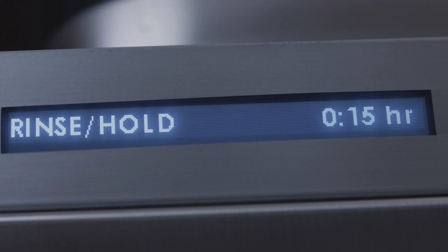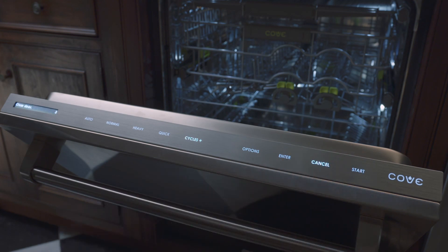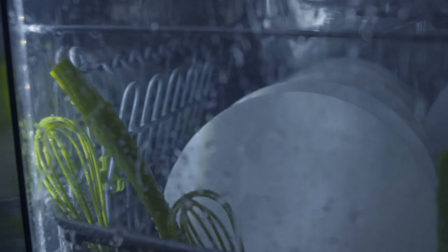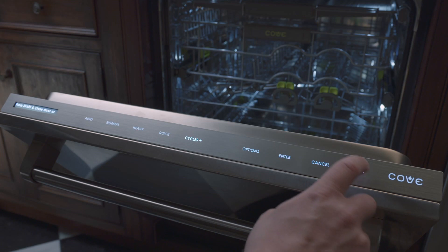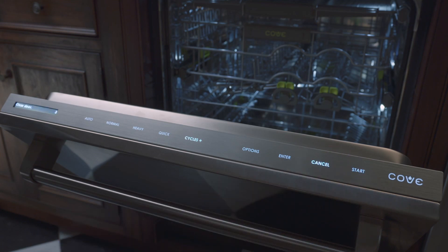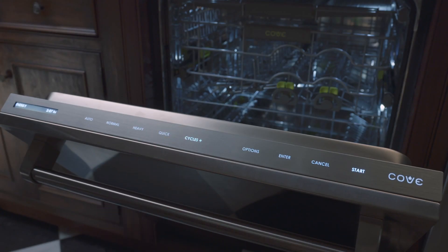China and crystal cycle: ideal for lightly soiled and temperature-sensitive items or cutlery — we recommend one-quarter the amount of detergent. Rinse and hold cycle: rinses food soil off a partial load and holds the dishes until you are ready to run a full load. Plastics cycle: improves drying performance for plastics — we recommend one-half the amount of detergent. Energy cycle: extends cycle time to reduce energy consumption while maintaining cleaning power — we recommend one-half the amount of detergent.